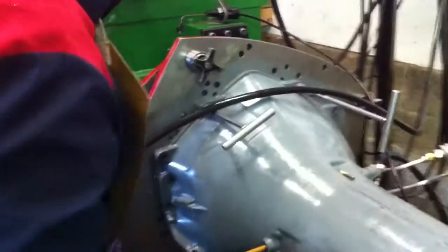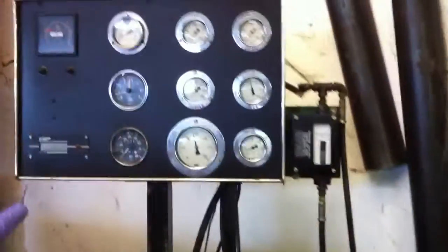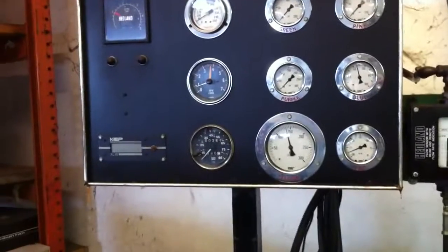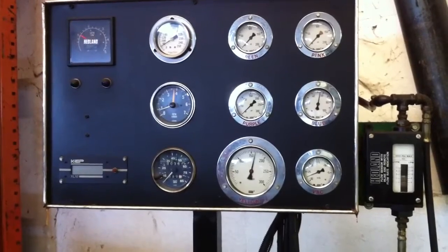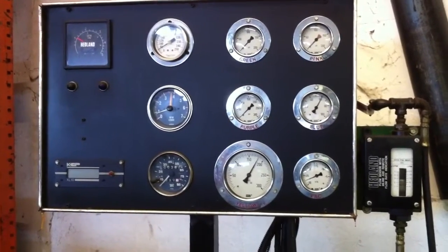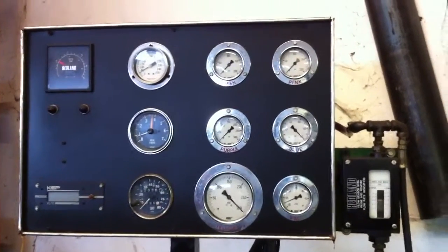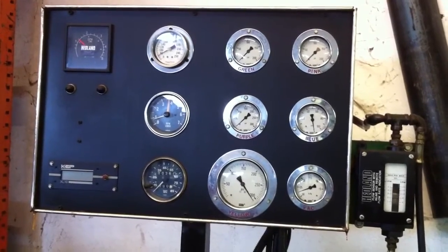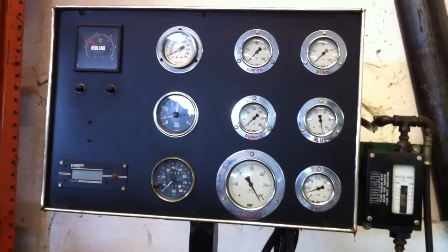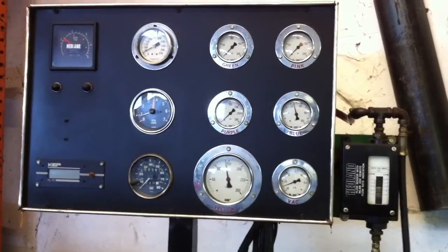Here's reverse. We're in reverse and our pressure reading is at 140. Now I'm going to pull on our cable and see what we get for pressure rise. You can see the rise is much faster - we're at 200, we're at 250, we're at 300. So that's in reverse, stalling it, probably about 1200 to 1600 RPM.